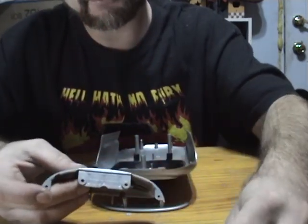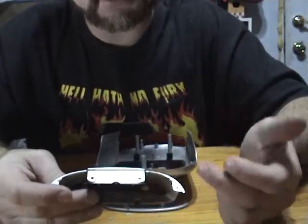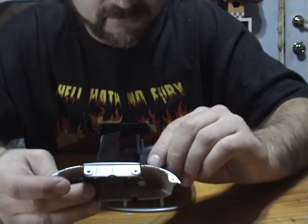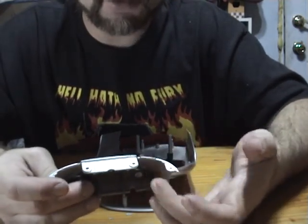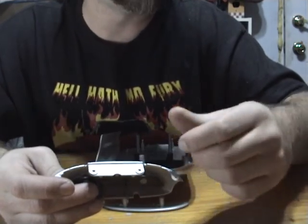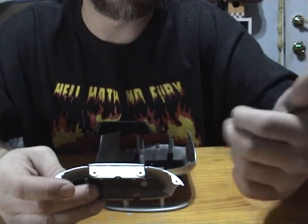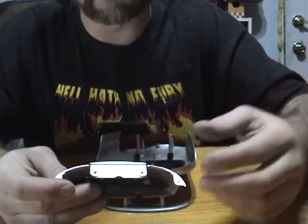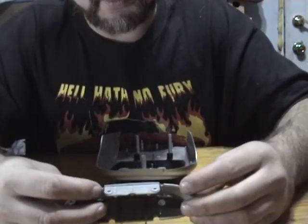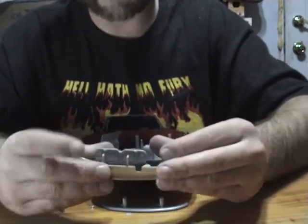Tail lights as well pop out. When I did the lights on the other one, I think I just stuck them up there with tape or hot glue and tape, but the hot glue melted because on the first test I was running off the batteries in the vehicle and tapping into the power, which doubled the voltage. You know what happens with LEDs when you do that — it got really hot and melted. No big deal, just had to use tape to hold everything in place. So now we'll go ahead and razor blade this.